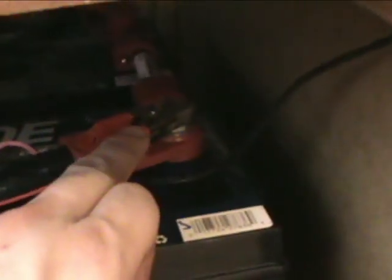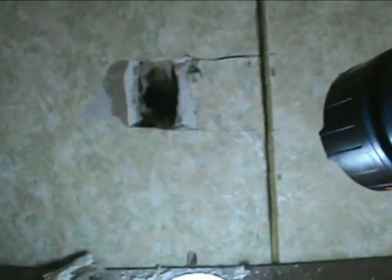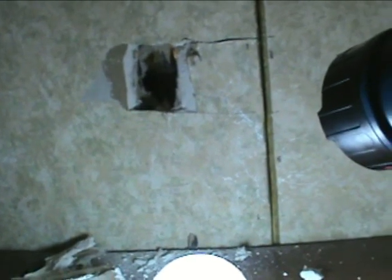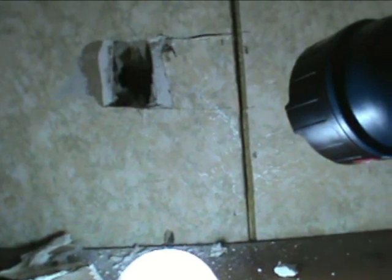What we're going to do now is — the fuse is built into the module, not into the line. From there, we've got the wires coming off the battery. All we've got to do is lift up our caps and hook right here both of the cables, just like you'd hook up when trying to boost off a car — hook your black to your negative, red to the positive. That runs up to the charge controller so that as the power is filtering in, it can run down to your batteries and charge them. I'll run that wire outside, and then I'm going to show you the complete installation outside of the three-way plug. Then we'll come back in and I'll show you how to run the discharge line for the batteries out.